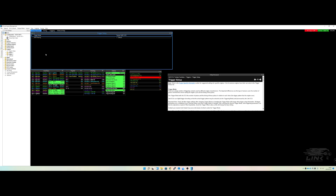When people say 'checking your timing,' some may say 'I've checked all the marks on the cams and crank and everything lines up' — that's the mechanical engine timing and that's fine. But when you put an aftermarket ECU on, you've got to tell the ECU: if it's 10 degrees on the ECU, you need to see 10 degrees on the engine. You could have the ECU outputting 10 degrees but actually have 15, 20, or 30 degrees on the engine, and that's not going to be good.